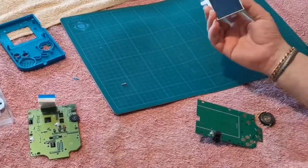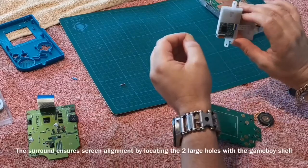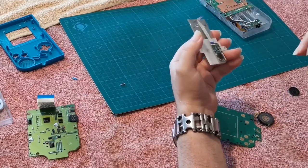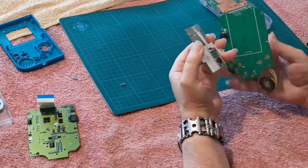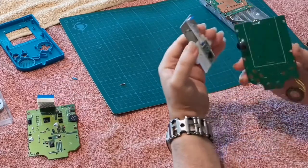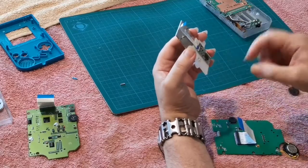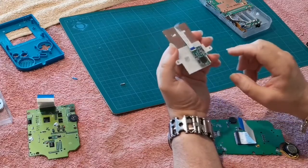So let's go to the actual screen. This is a Retro 6 kit, and it comes with this nice plastic 3D-printed thing that gives you a nice shape and surround to fit things to. You also have flat pins on the back — if you bend them out to 90 degrees they will make your life a lot easier in a moment. Only the top ones, not the bottom. Make sure your orientation is right and the kit goes that way around, into the hole. The actual case surround fits nice and snug around the outside of it. There's a knobble here — like a glue knobble — that gives your circuit board room to manoeuvre.